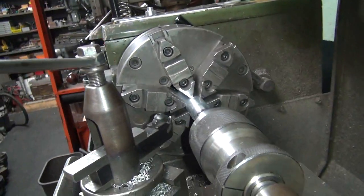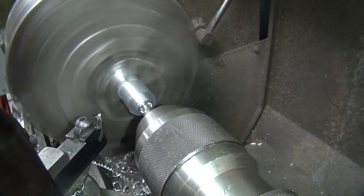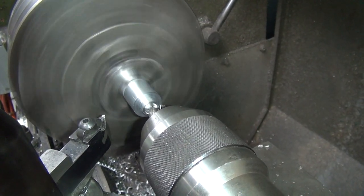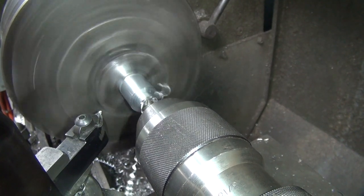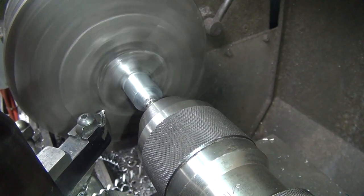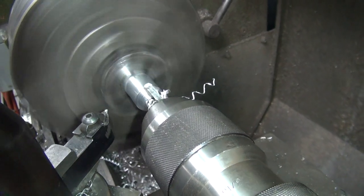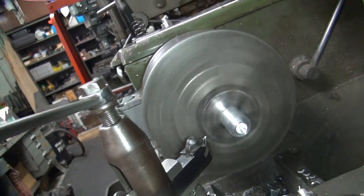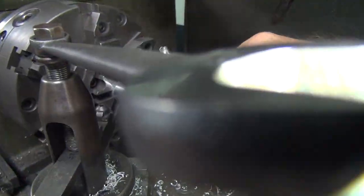So this cutter here, let me catch the center point for me. Right down here. Bounce it around a little bit, you'll let it catch your center. And then once you catch your center, you throw it on through. Now you can see how the center has been re-caught. Your drill in there, you have half a chance of going in square or concentric in this case.